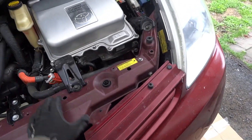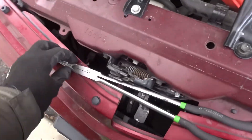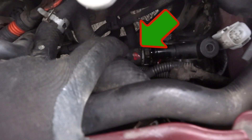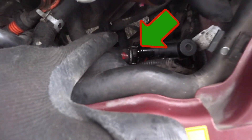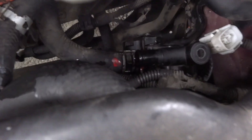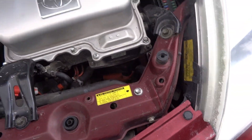I don't find that you need to take the headlights out. The tools you can use for these clamps — these spring clamps — vice grips are your huge friend. I have a bunch of pairs of vice grips, different pliers, long needle nose. I got the first clamp back, the hose back, and the top hose is off. So now what I do is I mark the bottom hose with something just so I can know for sure I don't get them mixed up — I know that's the bottom hose. That hose clamp is deeper down. I'm going to use needle vice grips, grab that clamp, hold it closed, and just leave the vice clamps on it. The lower hose we're actually going to remove down at that coolant storage tank.